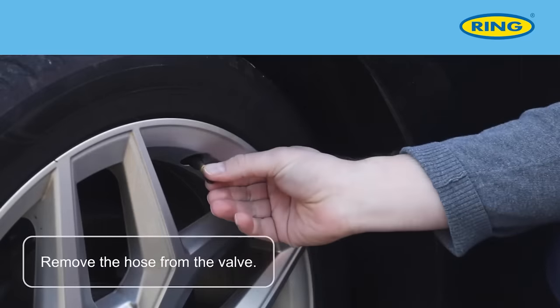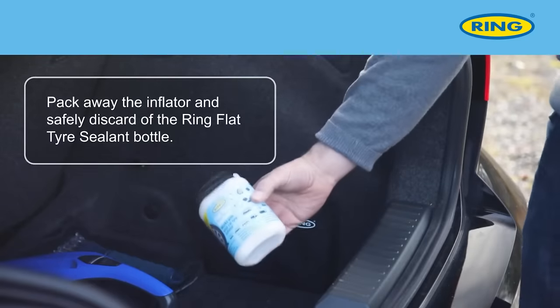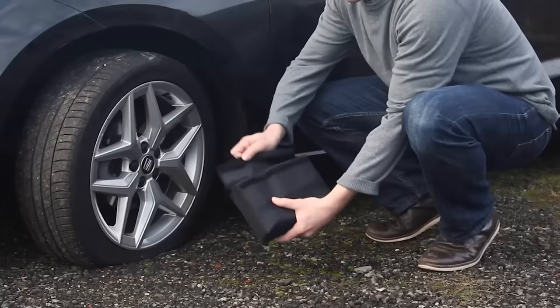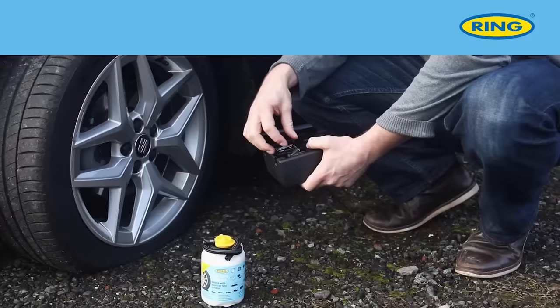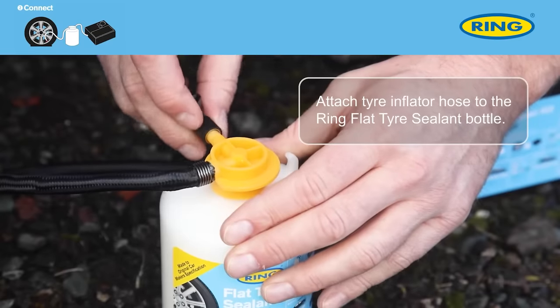The second part is the pump itself. Please note that the RTK4 is not a permanent solution to the problem, but just a way to get safely to some place where you can change the tyre. After using the kit, you shouldn't exceed a speed of 80kmph. The range of the repaired tyre is 200km in all weather conditions. The price is about $42.